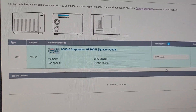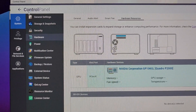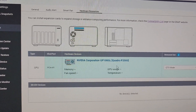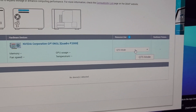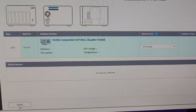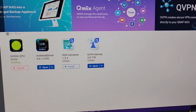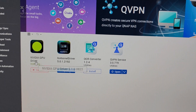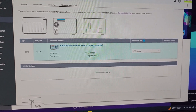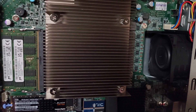Okay guys, before you go into the system, as long as you install the motherboard first, go to Control Panel > Hardware. You'll see the card right here. I'm going to use QTS mode because I want to use this card as the main card of this unit. When I press Apply, it's going to prompt that it needs drivers, which are being installed from Nvidia right now. Once done, I'll be able to select Apply.